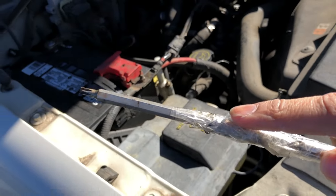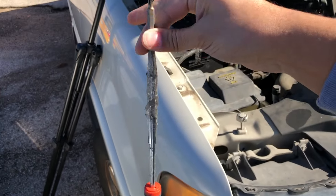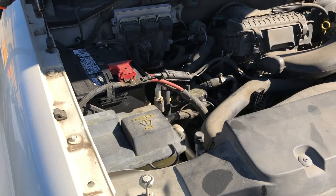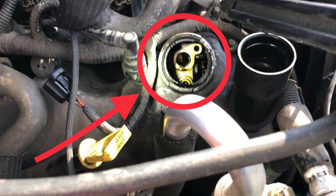That's why I put tape, just to play it safe — as you can see, this won't fall. I'm going to put the solenoid inside. I didn't have anyone to record while I was removing the seal, but pretty much what you have to do is use a flathead screwdriver and try to take it out. I know it's going to be a pain — it took me about 10-15 minutes. I used a flathead screwdriver and some pliers, and if you keep trying, you'll eventually get it out.